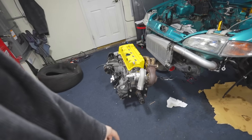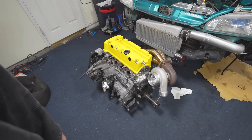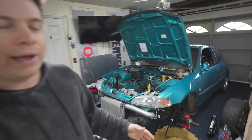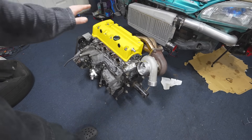How's it going guys, Drew Peacock here back with another video. It's a good day because the Honda should be back up and running today. I pulled it in about two and a half hours, so let's see how fast I can put it back together. The motor is back and we did not damage it. If you didn't see the last video with the Honda, we took it to dyno and had a low oil pressure light come on. We thought it might have been a sensor or the gauges misreading — turns out we did have low oil pressure, but barely. It was flickering on and off, not constant. We weren't able to adjust the cam timing so we didn't really get any full dyno runs. We thought we destroyed the motor, but after taking it apart with my boy, we inspected everything and there is not a single wear mark on any bearing or camshaft — no damage period.